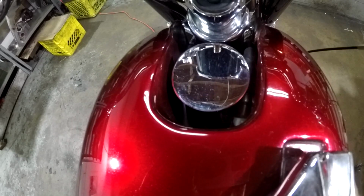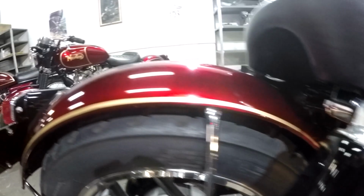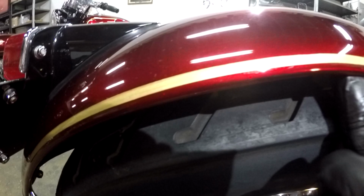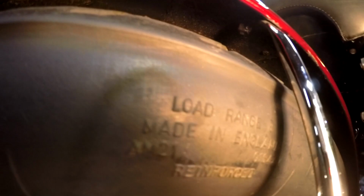The fenders, these are aluminum front and back, Wassell fenders, rare 6-inch on the rear here. This is a laminated fender, it's double wall. So underneath here I built a fender-like second structure, which is aluminum to this. Comes right to here, right to the taillight mount. Attached to there. Double wall right down to here, though you can't see it underneath there. And then it's filled with silicone.